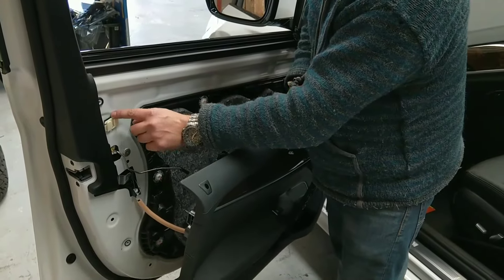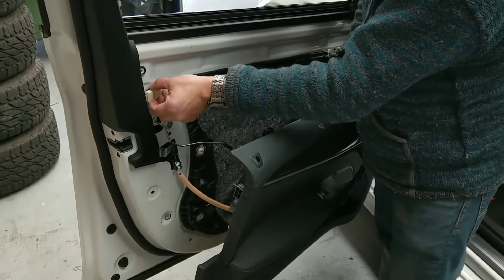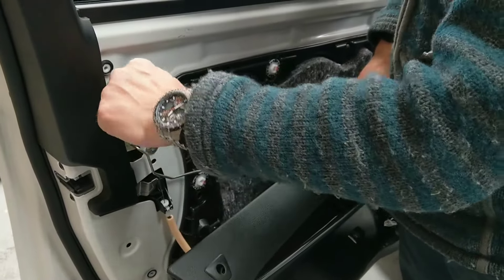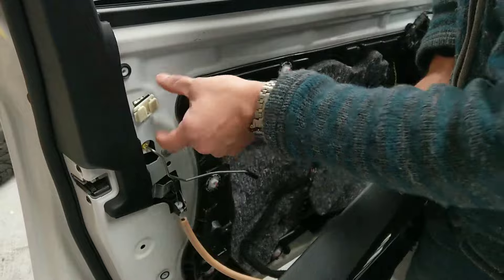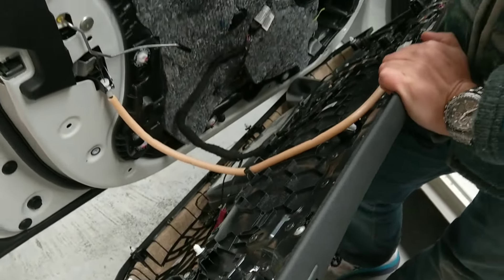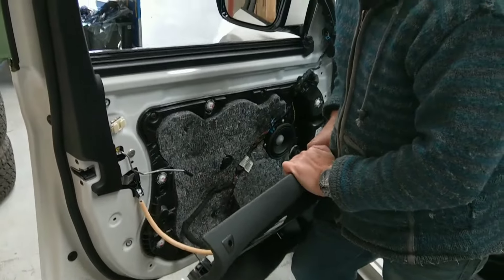And there's a plug that I'm talking about that slides. So putting it back together, that plug has got a pin in it — you push that pin down to release the plug. Slide that back onto the door trim, which is here. So when you put the trim back on, everything just pushes back in place.